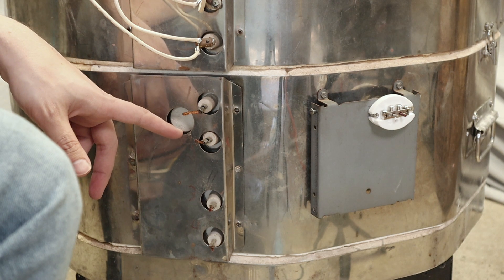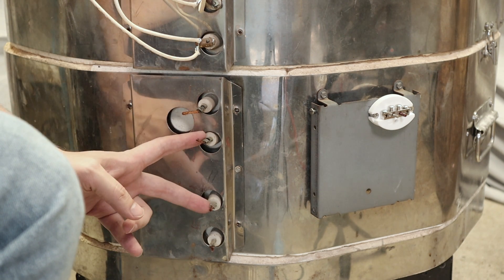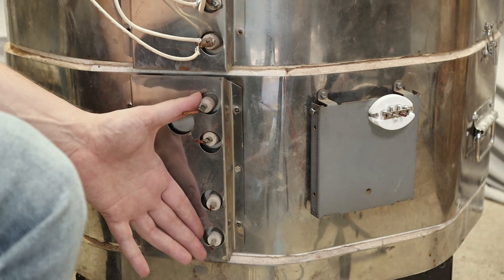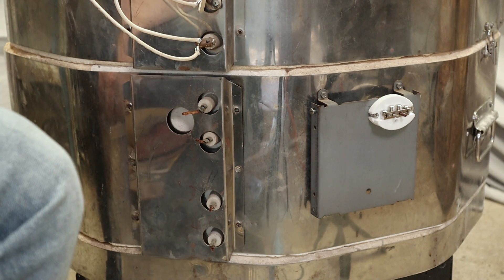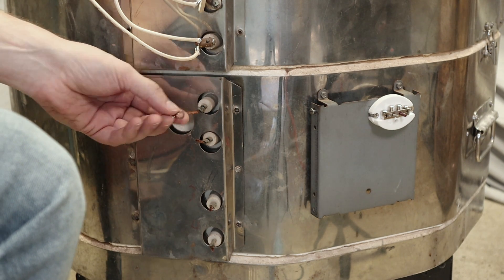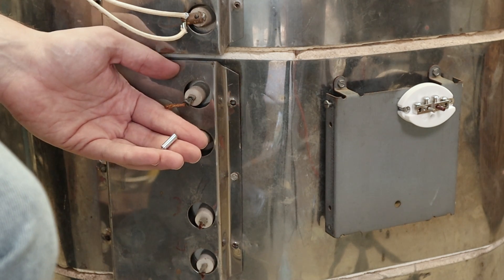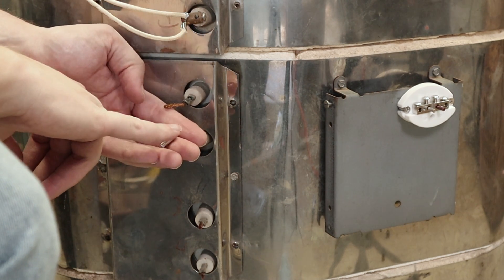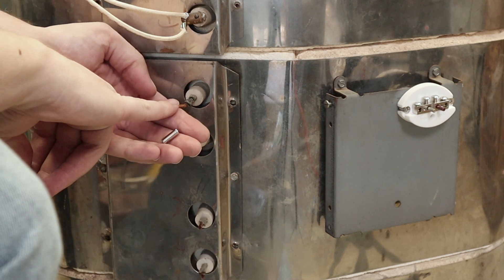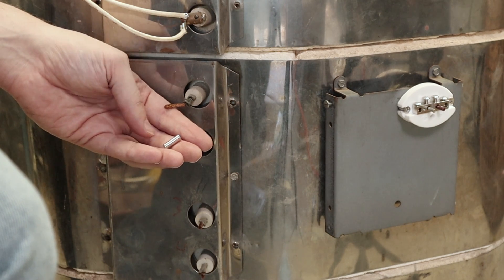With the top done, I need to do the same thing to the bottom. I'll wire them in parallel — create a jumper from one leg of the element to the other, then have wire coming back out to go to the relay. The big difference is these were crimped on, so I can't use screw terminals. Instead I need to use crimp-on ferrules. I'll crimp wire on both ends — crimping onto the little bit of original wire left here, then crimping the other side to new wire to make the connections.